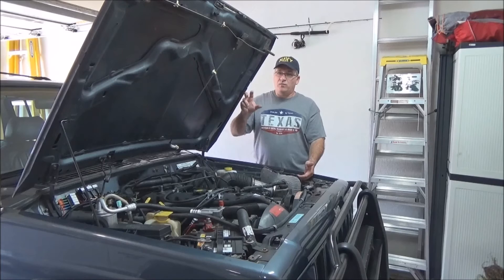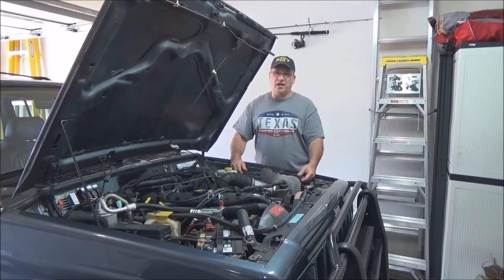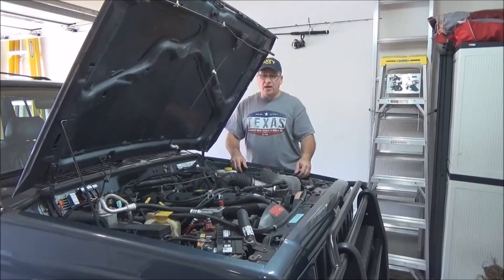That's the only modifications you need to do. Everything else is bolt-on. The other modification is you have to bend the hard line on the axle of your XJ just a little bit so that you can meet it with the soft line from the ZJ caliper. I'll show you pictures of how to do that. But again, the rest of this is all completely bolt-on.